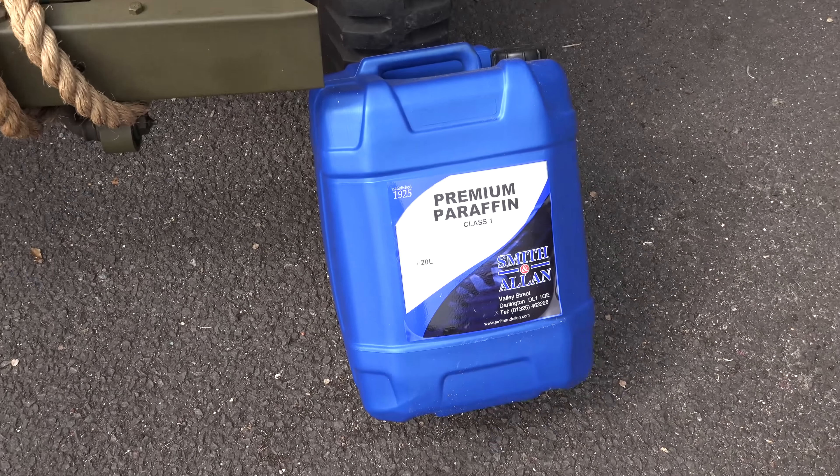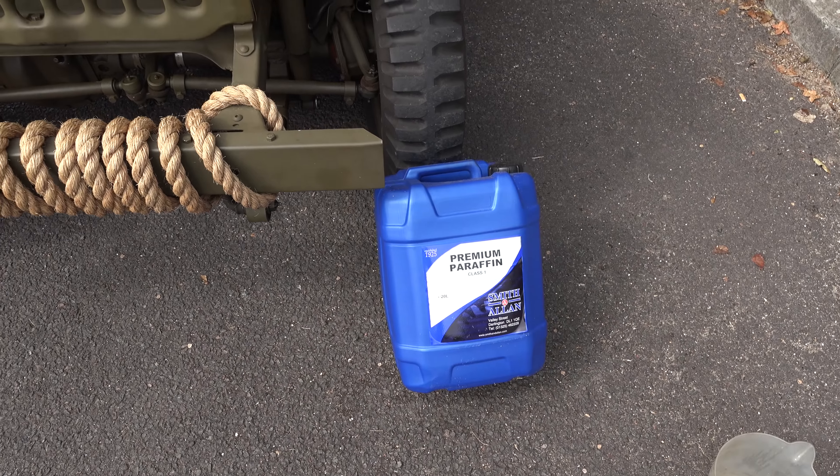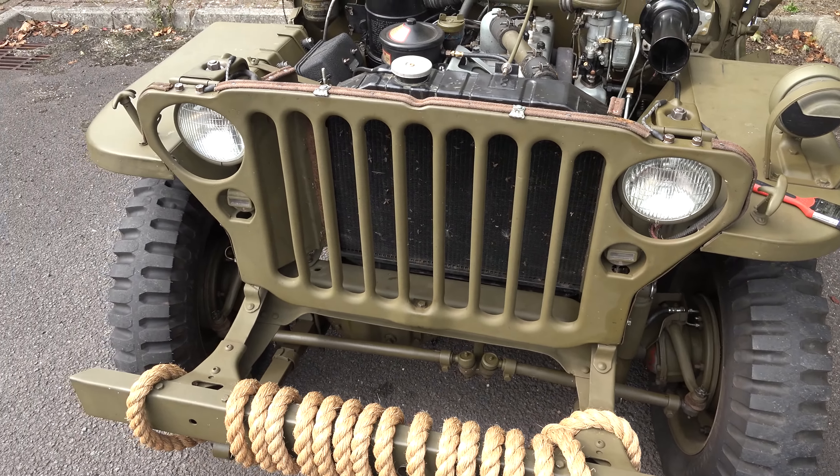One of the things we talked about guys was cleaning this matte paint on a jeep like this. I spoke a couple of videos back about the paraffin I'd found to use — it's a refined kerosene and you get it in big 20-litre tubs. This is great for washing the jeep over; it acts as a degreaser and a cleaner. You can manually clean it with water and soap beforehand, but as a degreaser this works pretty well as a single-stage step.